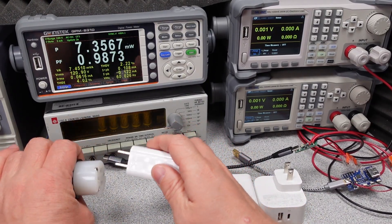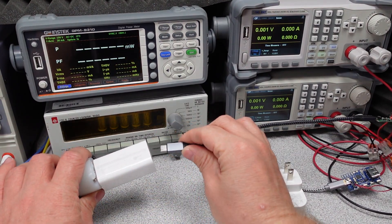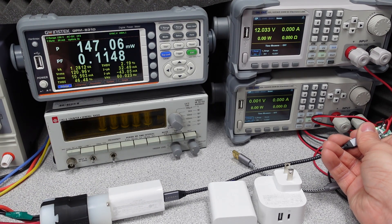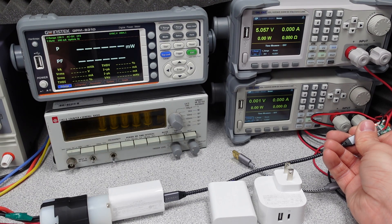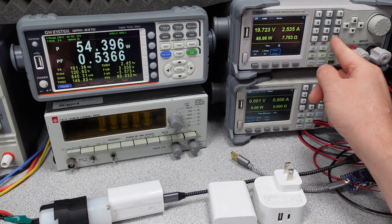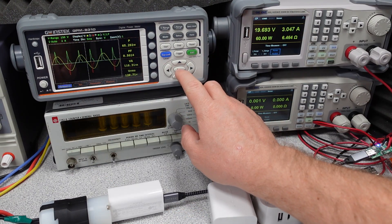I've had this adapter for a while, so my review is certainly later than others. This adapter has lots of modes of operation. It can do fixed output voltages per the USB Power Delivery 3.0 specification. The USB-C port can deliver 5, 9, 12, 15, and 20 volts. This adapter has no programmable power supply capabilities, so no Samsung super-fast charging. The cost for this adapter is $40 US dollars, which is expensive but not crazy out of line for 60 watts.